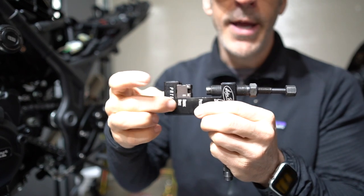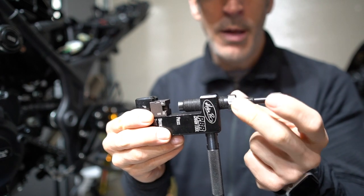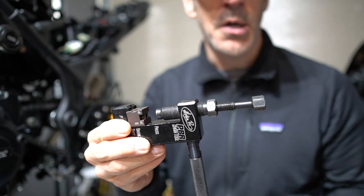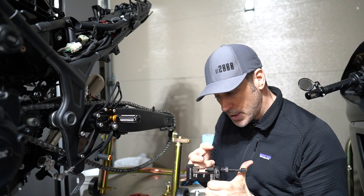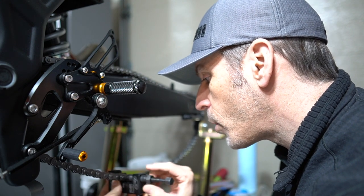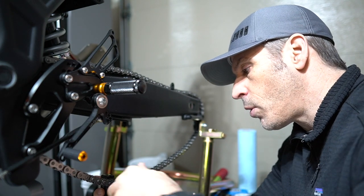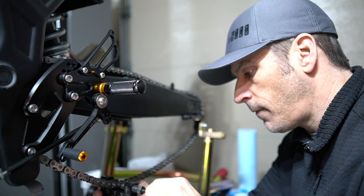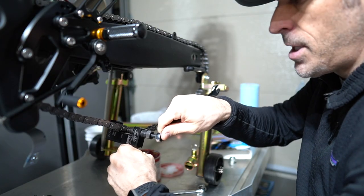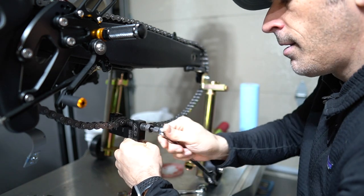In order to break the chain with the PBR tool, you place the chain in the block with the brake option. Then with a 17mm wrench you tighten this against the chain plate, and then you use the 14mm to push the pin across on the other side to break the chain. Put a dab of grease on this to make sure it's well lubricated, then secure it on the chain.